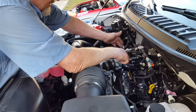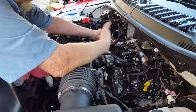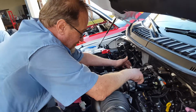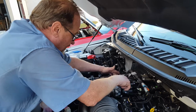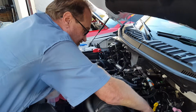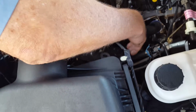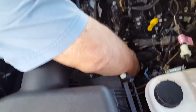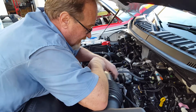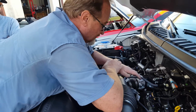We're going to use the intake manifold for evacuation when not in boost. With these small displacement twin turbo engines, that's only at idle and deceleration. So that's going to provide our idle and deceleration evacuation like it did stock. We're going to be using this barb then for our evacuation when in boost, and that's from the Venturi effect of the air that passes it is going to create a suction, and that's going to provide your evacuation suction in boost, which is most of the operating mode this is in.